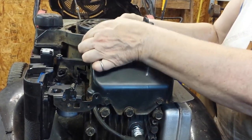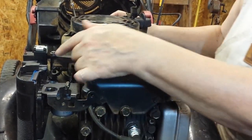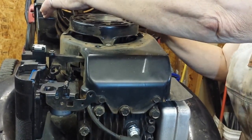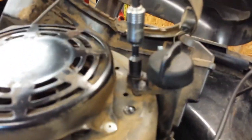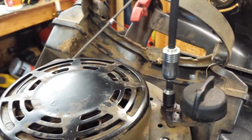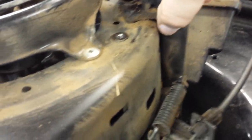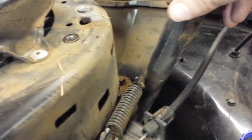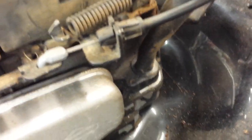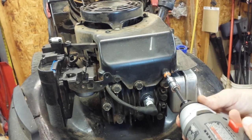And the gas tank you normally can just fold back. Sometimes it will disconnect from the carburetor, so you got to be careful of that, but this should be all right. And that again is another shoulder bolt, so you don't want to lose that. And if there's any chance that there's rust or corrosion, you don't want to use an impact tool — you'll want to take those off by hand.